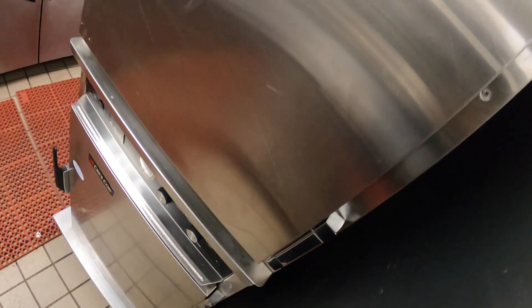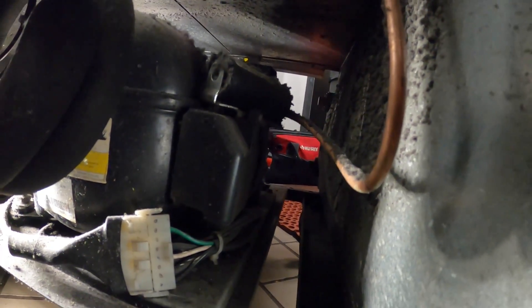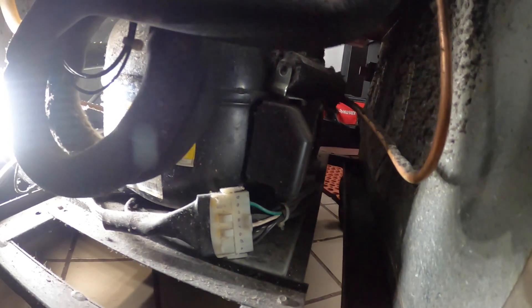Let's see what's going on through the back. There's a bunch of food back here — nasty. You can see the condenser fan running. Compressor is running, clearly. Evaporator fan — everything seems to be running. It's super dusty. You could have issues when it's clearly dirty. Maybe that coil is packed and it's overheating at times. I wonder if there are any pressure controls — I don't exactly see any. Maybe the start capacitor and starting components are on their way out, so sometimes it works and sometimes it doesn't.